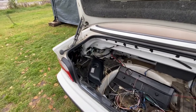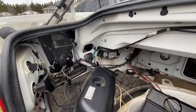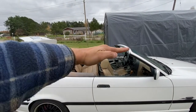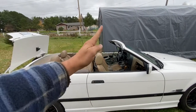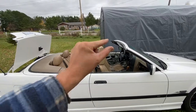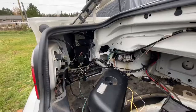In the trunk you have two motors. One motor controls the door that goes up and down, and this other motor controls the roof part that comes out. In some cases there's a third motor that controls the manual pull part. If you do have this motor, you have to make sure it's set all the way back, otherwise two little hinges will pop out — I'll get to that.